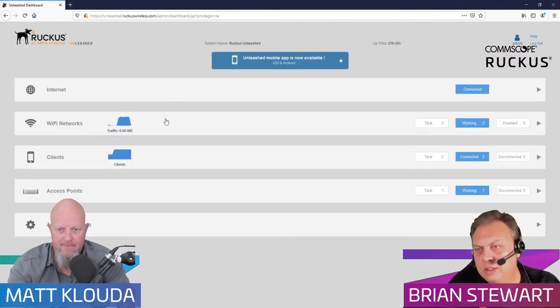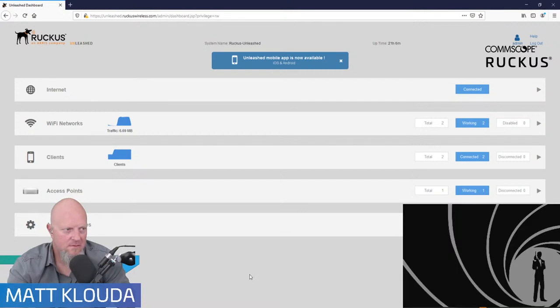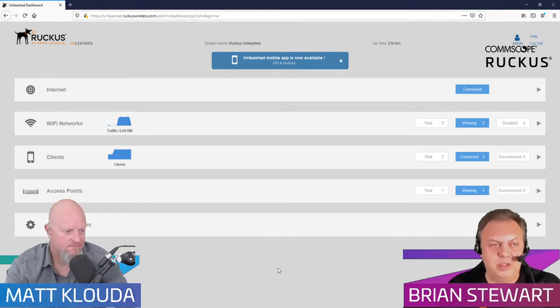Okay. And a question did come in and said, if the AP has multiple ports, is Beacon able to transmit only on a single port or on all ports, or can it be configurable for a specific port? Well, a Beacon is a Wi-Fi component, so that's going to go over the air. So that's going to go over your 2.4 gigahertz or your 5 gigahertz radios, not a physical port. You can configure whether you use the 2.4 or the 5 gig or both.